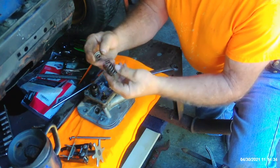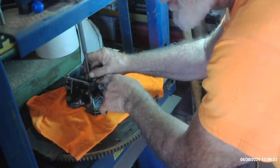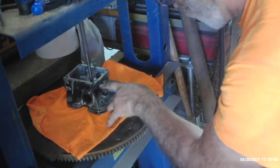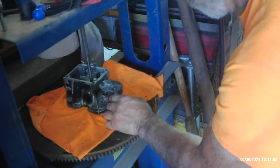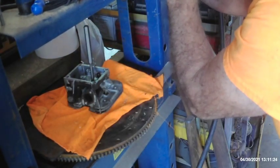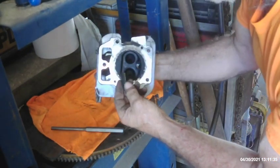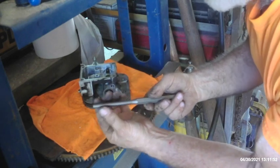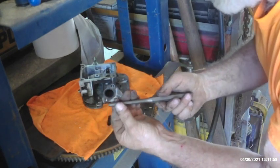Here's the little bonnet, here's the valve spring — the valve will go out the bottom side. I've got a pin punch large enough to push on the outer surface of the valve guide, with enough pressure to hold the punch in place. I'm just going to gently push down and push that guide right out the other end. The reason I want to use a pin punch is because it has no taper — these are made to drive out pins of a specific size, so I picked one approximately the diameter of the valve guide. If you use a tapered punch, you're going to do some damage inside that head.